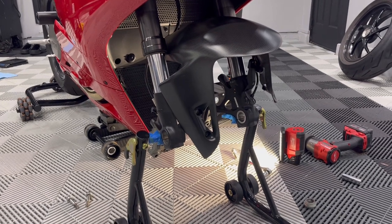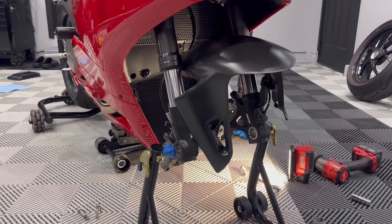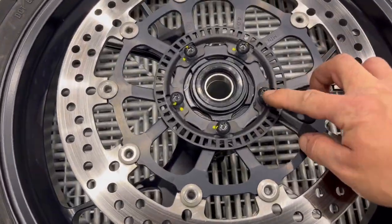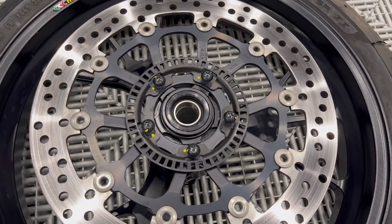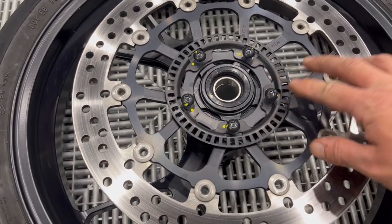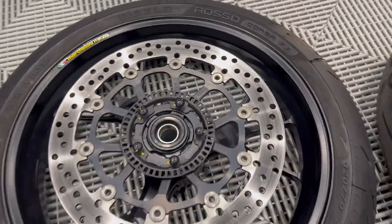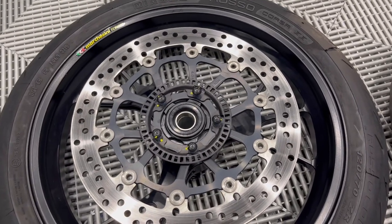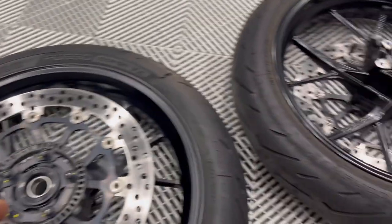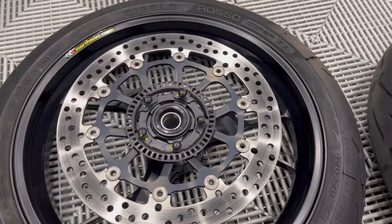When you're removing it, make sure you're careful the brake calipers don't hit the wheel. But other than that, really straightforward. Now it's time to remove the brake rotor — pretty easy. These are just T40s. I use an impact gun; you don't have to, it's just a little bit easier. A three-eighths ratchet or breaker bar will work as well. Take your T40 off — there's five fasteners — then just lift the brake rotor off the old wheel and put it onto the new one. Make sure the wheel is going in the same direction: keep the right rotor on the right side and left rotor on the left side.